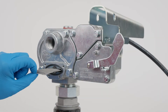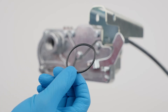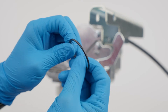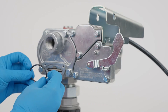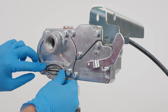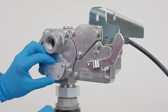Place the strainer in the cavity, then remove the O-ring from the pump, coat it lightly with grease and reinstall. Ensure the O-ring is seated securely before reinstalling the cover plate.